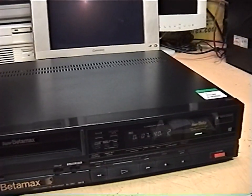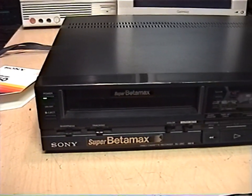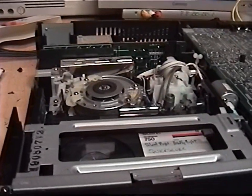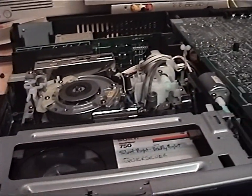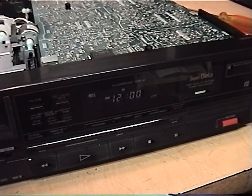But we can't judge picture quality based on that, because the tape may have been bulk-erased and maybe it just wasn't a complete erasure. So what I'm going to do — the whole reason I'm using an analog Hi8 camcorder to record this — is connect its video output to the video input of this VCR and try to do a recording on Betamax. The cover is removed because off-camera I had my first tape-eating incident with this VCR. It wouldn't rewind at first, and then when I tried to eject it got stuck halfway and it still has problems inserting and ejecting. I think probably the belt responsible for that is worn out. But I did get it to load the tape and I was able to fast forward and rewind it, so rather than tempt fate by ejecting again, I'll just try to record now using the video from the camcorder as the source.